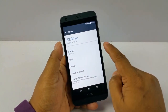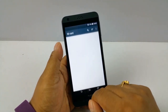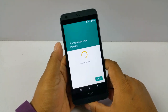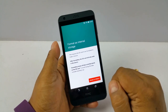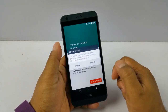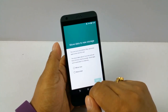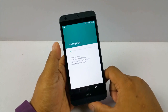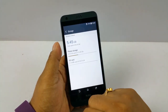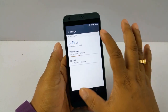I have a 32 GB card inserted here, and this device has 16 GB of internal storage by default. So we go here and format this as internal. Before formatting, you get a reminder that after formatting, the SD card will only work with this device. We erase and format, move photos and files to the new SD card, and there you go — total storage shows 44.29 GB, so effectively I have 32 GB plus 16 GB merged in this device.